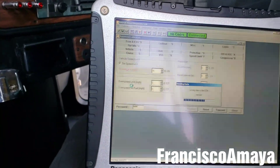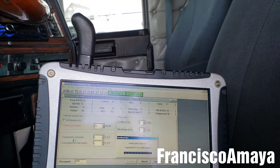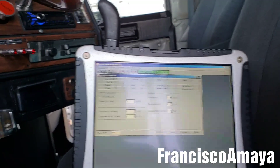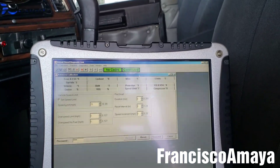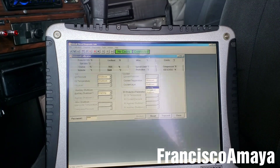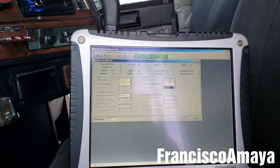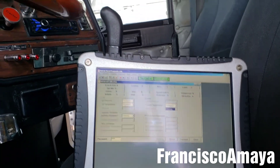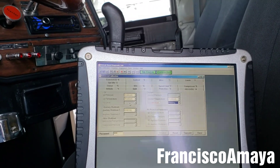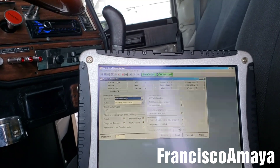You know how it is if you're a driver or owner operator. This was pretty simple. You have the coolant protection mode — this one didn't have the SER system, just coolant. It's good to set coolant level to warning mode, because if the coolant level gets low it shuts down, and when the coolant temperature is too high it shuts down too. Warning is good for the coolant level here.